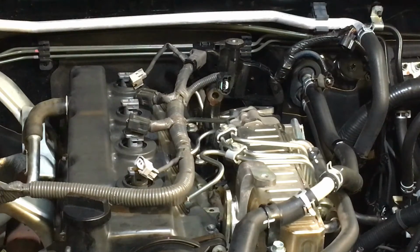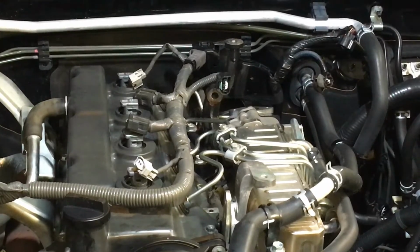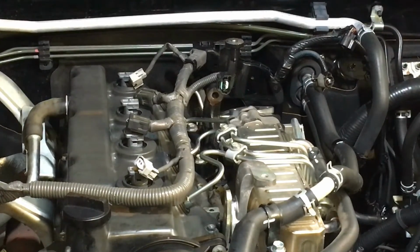We've got the fuel pipes on, so what we start doing now is pumping up the fuel system because it's sealed, so it's worthwhile doing now, and get some fuel up to the system, and it'll go soft again, go hard again. It does help. Generally, if you pump it up enough, the vehicle will take approximately 6 seconds to start, okay? So to give you a guide, how long should it take? I haven't done that before. The most common is 6 seconds, quite often it's 10, 15 or 20 seconds.